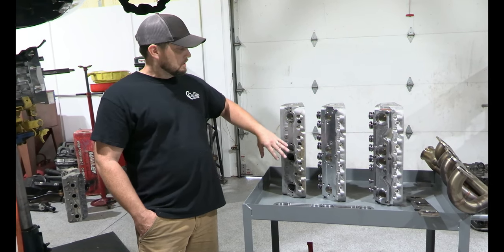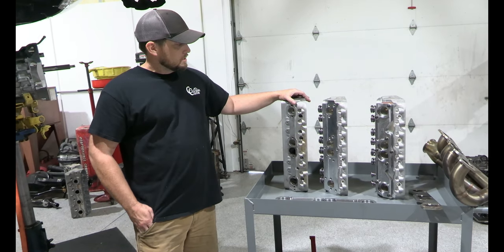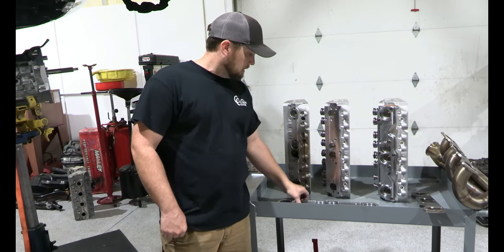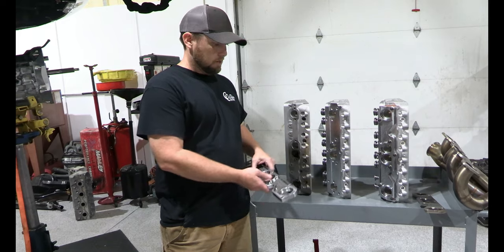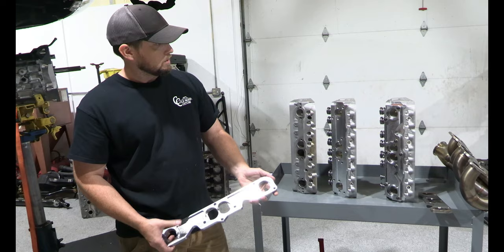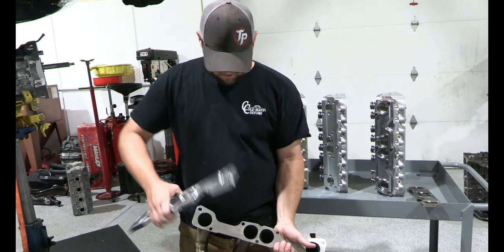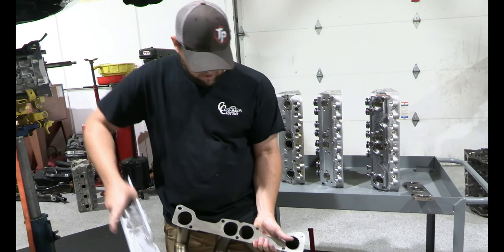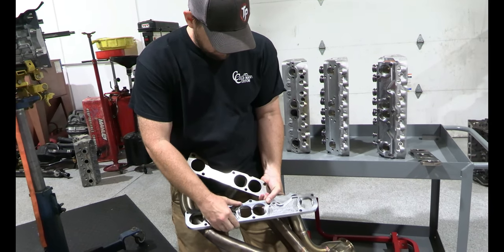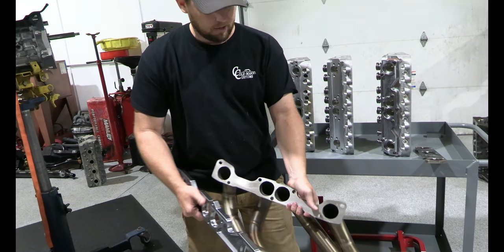With the heat, the back pressure, the flanges warp, then the gasket pushes out, and it's just a constant battle for us, it seems. So what we've done is we had our guys here in the machine shop, Matt, he did some custom flanges for the headers. You can see our header here, the current header. Turn this around. If you compare, you can see we've added a bolt down here where this header had no bolt, and otherwise it's just a lot thicker.